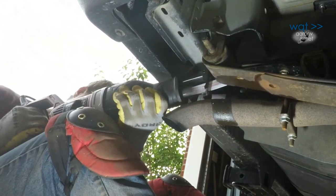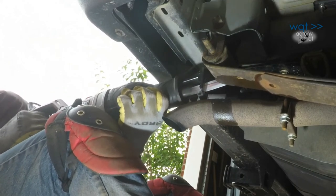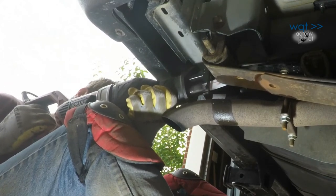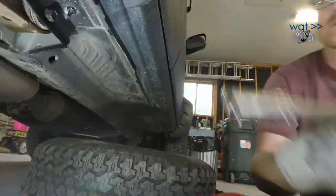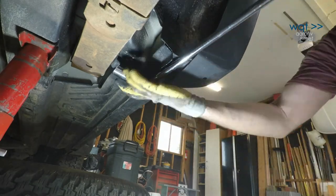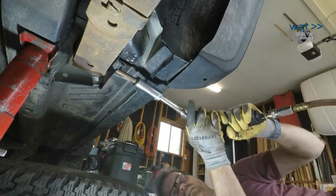The saw did slowly go through, but what we ended up having to do was bend out the shackle away from the eye slightly and then saw through the entire seized assembly of the inner eye and the bolt together. And that, of course, was hardened steel and not at all pleasant. It finally came out, and then the front one turned out to be more of the same. But thankfully, since there's no way to access the rear weld nut on that, it did finally come out with a lot of PB Blaster and a lot of torque.